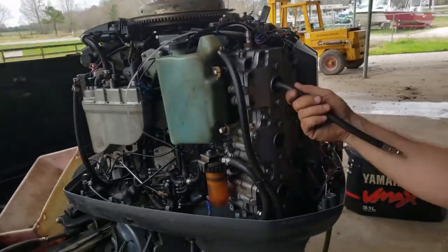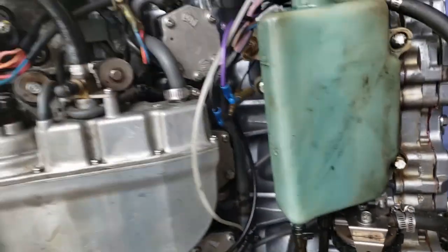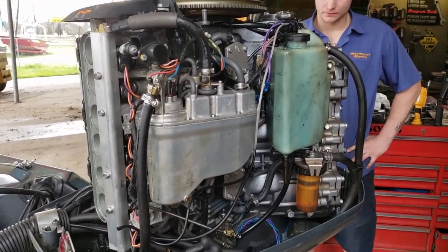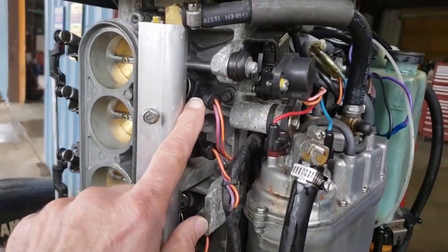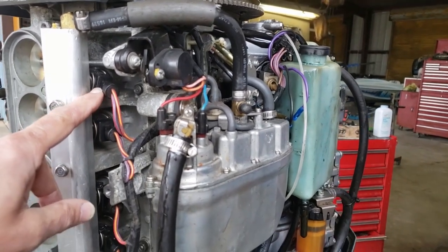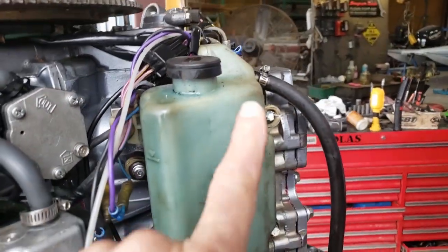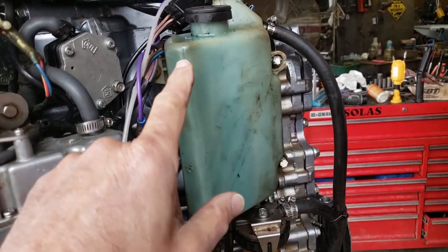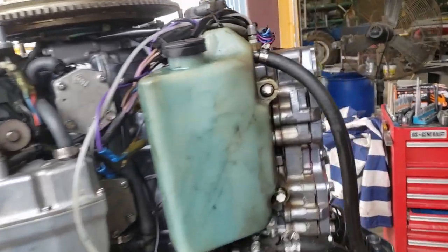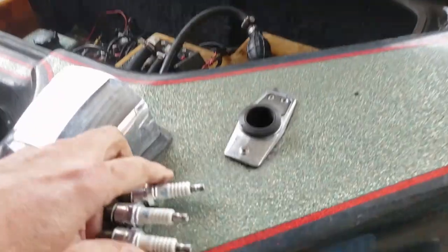We know that cylinder is cooked. This power head has to be torn down — that cylinder needs to be bored, one new piston and rings, a few gaskets including a power head gasket, but not a lot of parts. It's going to be a relatively inexpensive repair, except we don't know why it failed. When we stop filming we're going to test this fuel injector, check the spark, and test the oil tank float to make sure we're pulling oil from that tank. If the oil tank emptied while this motor was running, it certainly would have burned more than just the number two piston — compression and spark plugs on the other cylinders look really good.